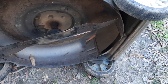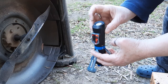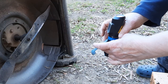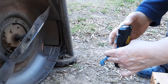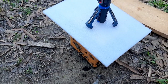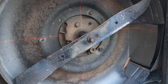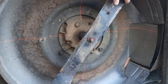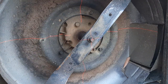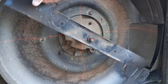But I'm going to put a laser on this and see if the crankshaft is bent. I bought this little self-leveling crosshair laser, and it takes a little machinations to get it level and set up. I've got it set up on an old battery and about a quarter inch piece of styrofoam. As you can see, the crosshair is right in the center of that bolt. I'm going to rotate this blade around and see if that crosshair moves — and it does not. So I'm going to rule out the crankshaft being bent.